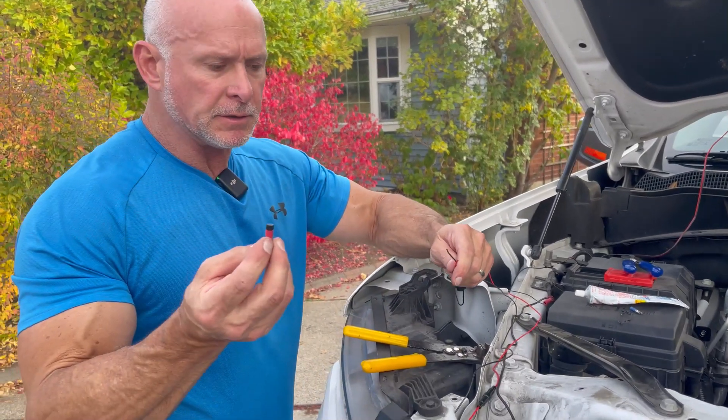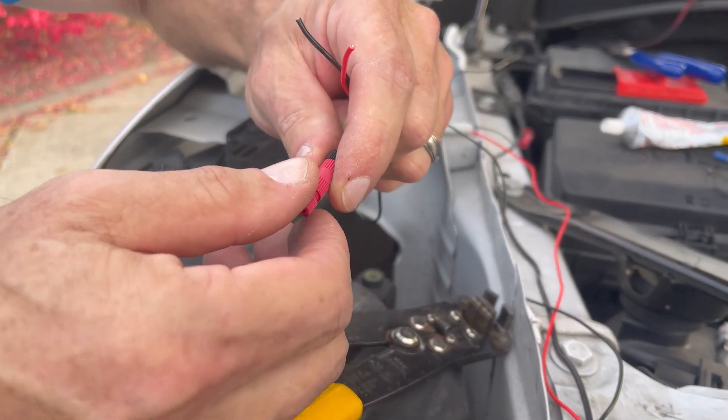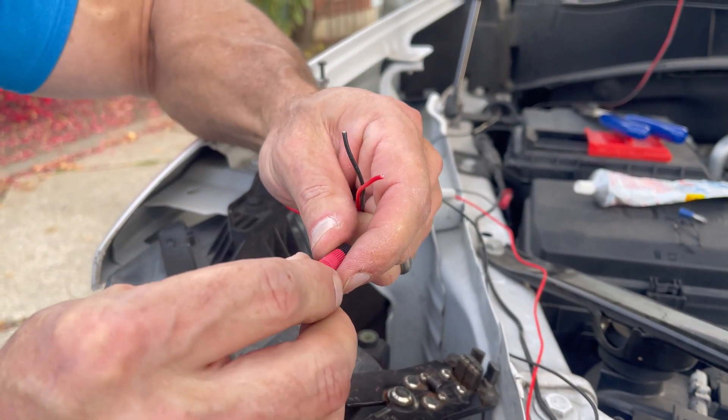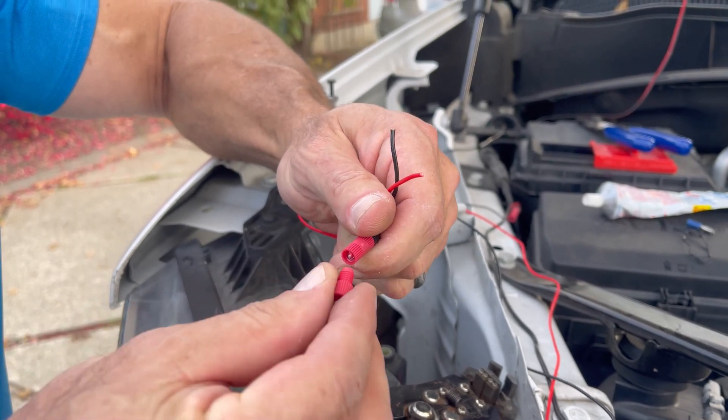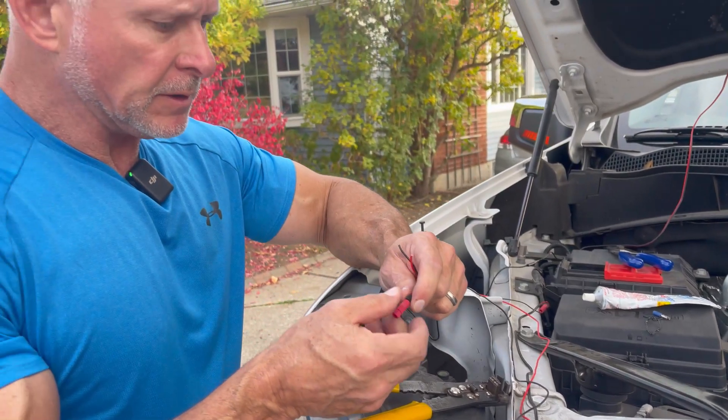Use Bond 527 — no affiliation — and put a little bit here and there as you go, because the factory 3M adhesive tape isn't the strongest and won't last the way you'd like it to. When you get to the end of a section, just peel back another foot or so and get it up in there nice and tight.